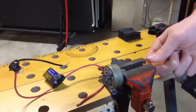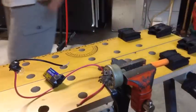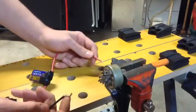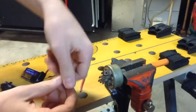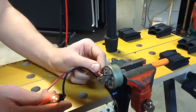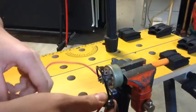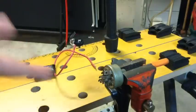Now set it into the headlight position — turn it one click. This is to make sure it will run while your lights are on. This will be the same for the run position too; unless your mower does not have lights, you just have to test this position. We're going to connect B and L and check for continuity between them. We have continuity between B and L — battery and lights — so that works properly.